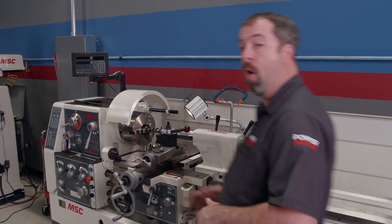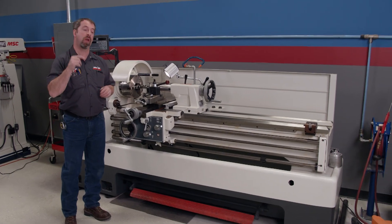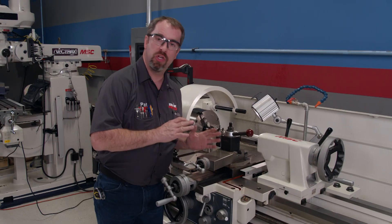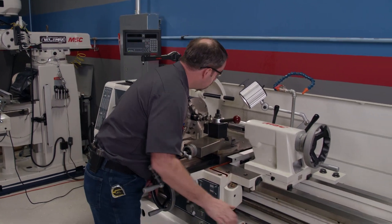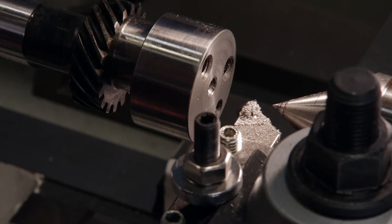Here's where you have to get a machine shop involved, because most people can't do this themselves. But we're going to show you how it's done. Over here in the lathe, I chucked up an old cam out of another engine that had an extreme amount of runout — over twenty-thousandths at the gear — and it's very easy to see. We're just going to take off the minimum amount so we get 100% cleanup on the cam. Once finished, the cam gear will run straight and true. Problem solved.